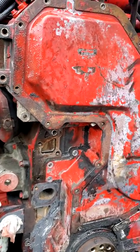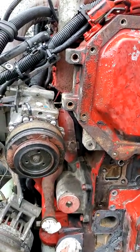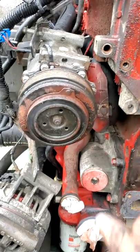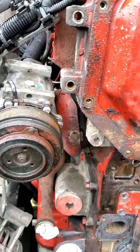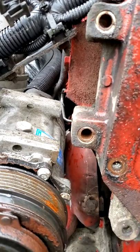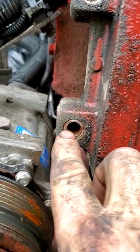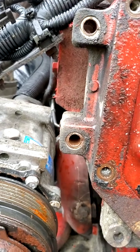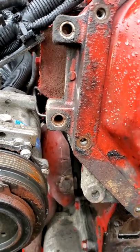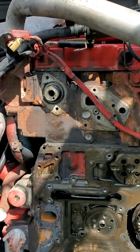Quick note — I had to put the covers back on since I'm doing this outside. To remove this bracket that holds your AC and alternator, there are only three bolts holding it on. But you have these tiny little spacers — take a set of vise grips, squeeze them, then rotate them a little bit and they'll pull out. They're slightly indented so they sit in really tight; you can't just pop them out by brute force. Squeeze them, turn a little bit — bam, comes right out.